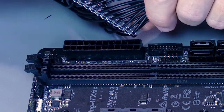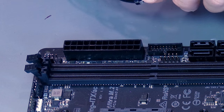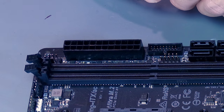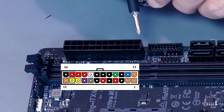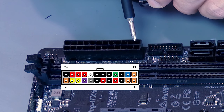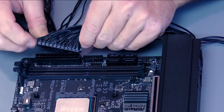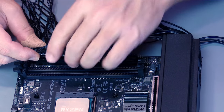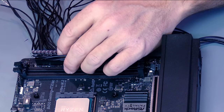Just a quick note: when you're lining up your wires, I marked pin one right here. When you're looking down at your 24-pin ATX connector on your motherboard, pin one is the square one on the top left-hand side as you're looking at it, and it's 1 through 12. Then the rounded one below it is 13 to 24. So make sure I got pin one lined up, and pin 24 — which would theoretically be my longest wire — still has some slack. This is where I'm going to cut it all off.